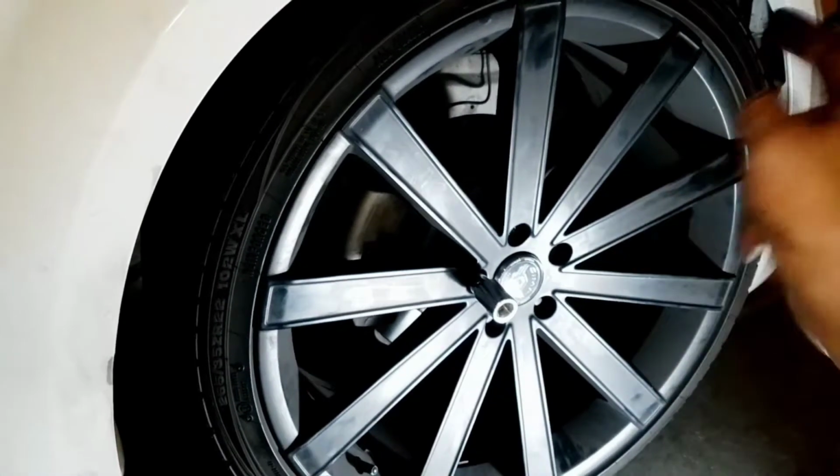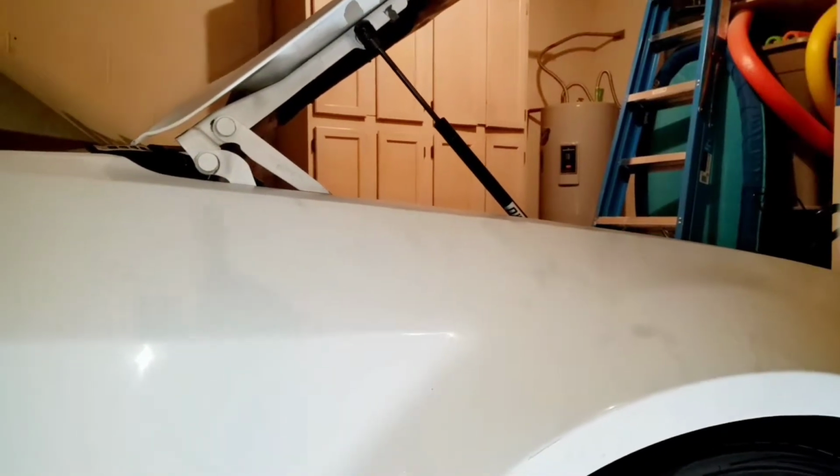Now I'm going to go ahead and get these torqued down, go back on the top, torque down those bolts, so 50 for each side, but I'm not going to do it. I'm just going to torque it down as hard as I can with this guy, and then move on to the struts. Get the struts torqued down completely. Remember, premature wear if you don't do it right.